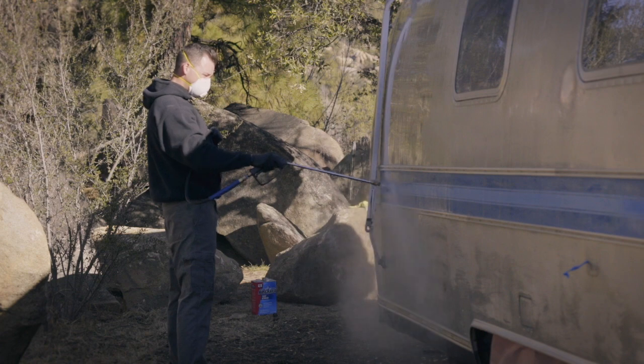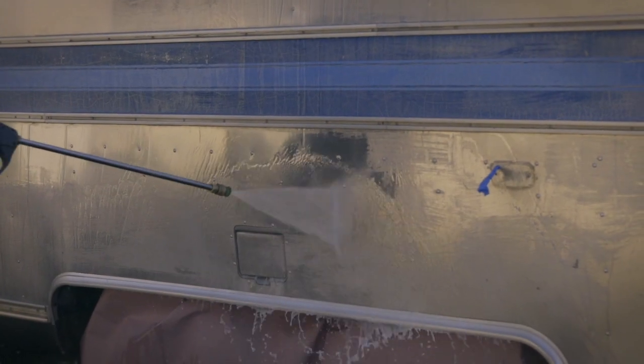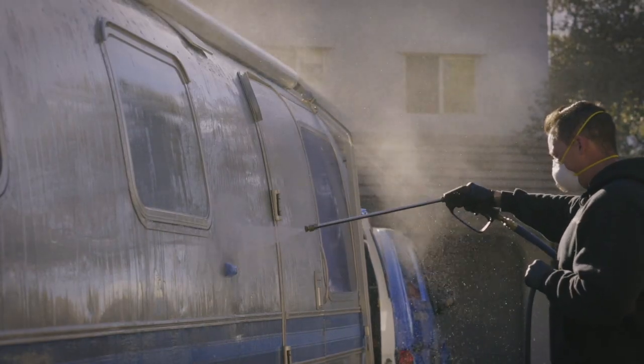So we're painting on the strip remover — we're going to take off the clear coat. The whole Airstream is pretty dull, it's pitted, it's heavily corroded. It's never been polished in about 40 years. What we need to do first is take off the clear coat.